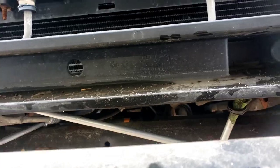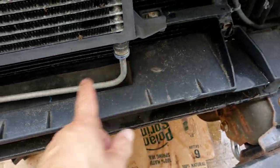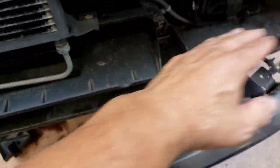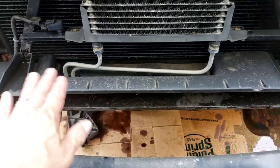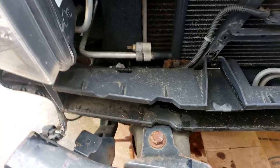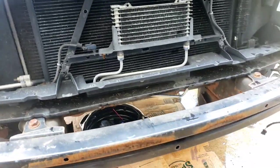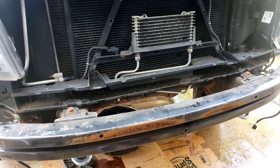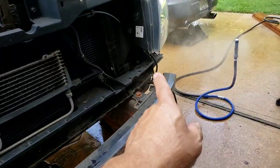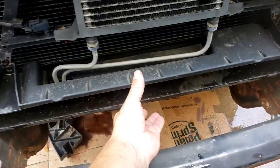If you want to butcher it, get a sawzall on the bottom and just cut this whole thing out. After you pull the nose out, don't forget your little fog lights over there and then you get to see this. Once you see this, then it's six bolts and this retainer here will come right out. See the little slide here that I talked about — once you slide this out, there are two Christmas tree clips that hold the wire harnesses. Once you pull this out of the way, look at that — there's your line.